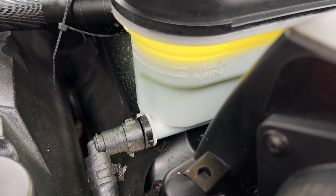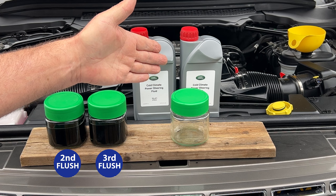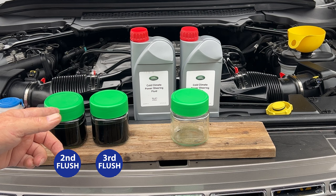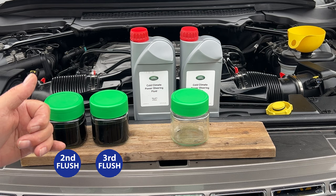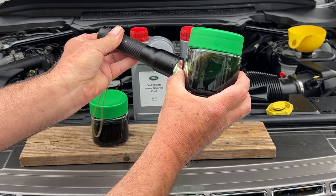What I usually do is let it sit for at least half an hour to make sure there are no air bubbles in it. When the pump's working it'll pump the fluid around and you don't want any air in the system. Then take the car for a run — about 10 miles, go around some roundabouts to put the power steering through its paces. When you get home the fluid will be hot.